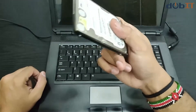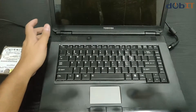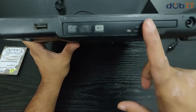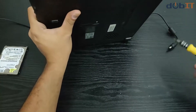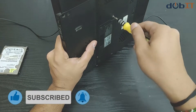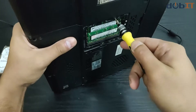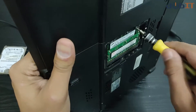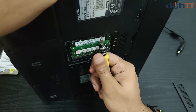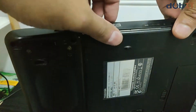I can show you what you can do with your extra hardware. What we can do is get rid of the CD-ROM drive. To do that you basically need to open it down here — the screw holding the CD-ROM for this laptop is located right here; for every different laptop it's in a different location. CD-ROM out — once you push it, it should pop right out.